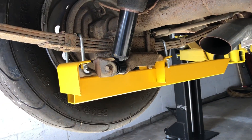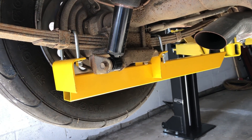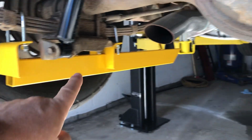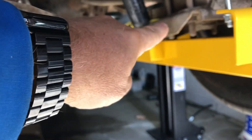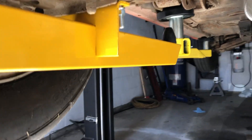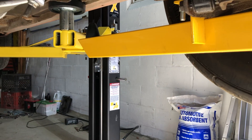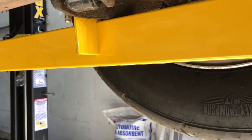Underneath the car you can see I've got the traction bars just kind of hanging there right now. On the driver's side the shock is in the back, and on the passenger side the shock mount is in the front, so this whole perch is uneven from side to side. I've already taken a measurement where the rubber stopper is going to hit on this side and this side, so they actually are even the way they're hanging right now.